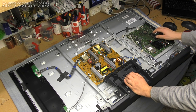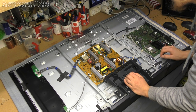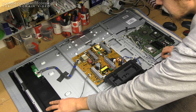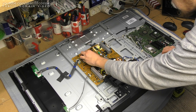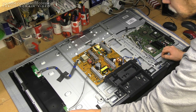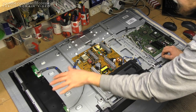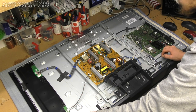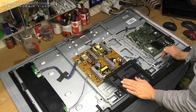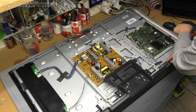The TV might have some intermittent issue if the solder joints on that have gone bad. Tcon construction - that board fails, it's just dead. You have to get a new board. But it seems to be in good working order. We've got the inverter here on the power supply, so that's probably going to be in good working order as well. This is just going to be a breakout board for the CCFLs going across there. These TVs are not edge-lit like a computer monitor - they've actually got tubes going across. Some even have tubes going both ways, and this is probably one of those.